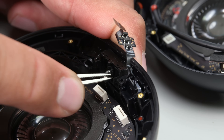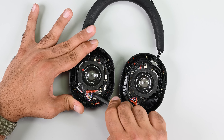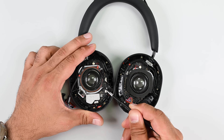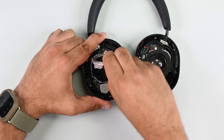This wasn't my intended route of entry, but to remove this casing I had to access this C-clip. With the buttons out, we can remove the flex PCB connecting one end of the wires passing through the headband. There are four more screws hidden underneath this adhesive cushion, and removing the screws and applying a little elbow grease is enough to dislodge the driver.